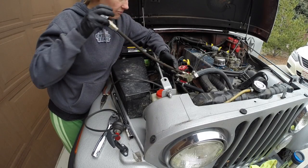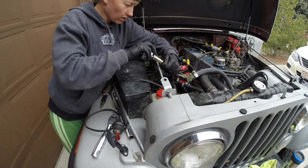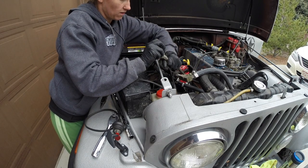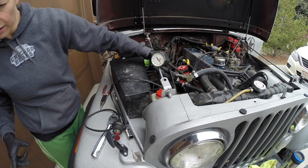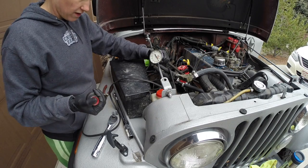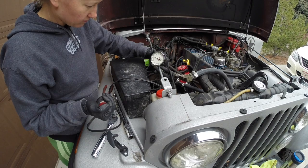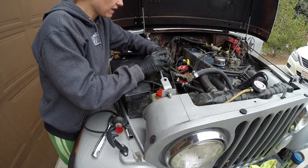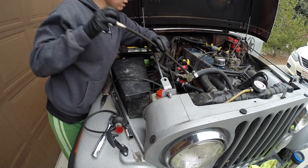Alright, now we can use my remote starter. I've already checked my O-ring — make sure that it is solid and without need of repair. Alright, so we've got that. It's zeroed out. I'll try and make it so that you guys can read it as well as myself. Here we go. That's reading about 165 — cylinder number one.